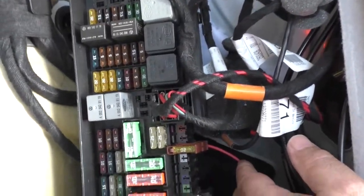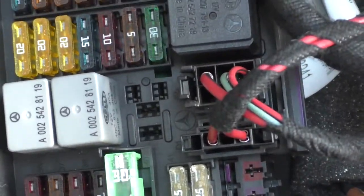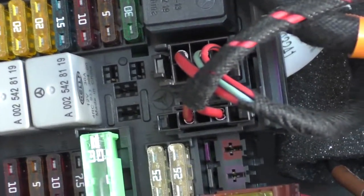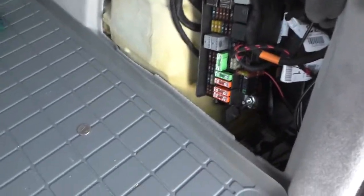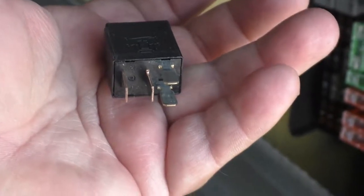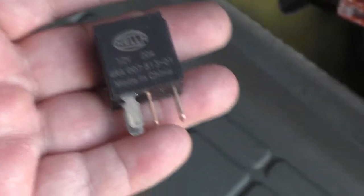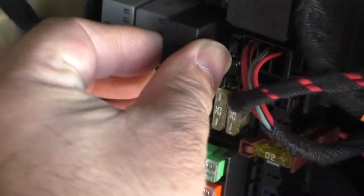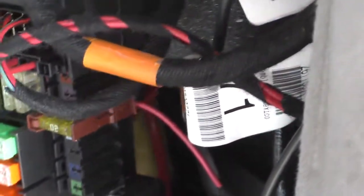And then the socket, the vacant socket for the hitch relay is right here next to this, to the plug. So we'll go ahead and take the relay out. And this is the actual relay, the same relay is used in many functions in the car. So it's kind of a utility relay. And we'll just plug that in right there. And that completes the electrical wiring that we can do here.